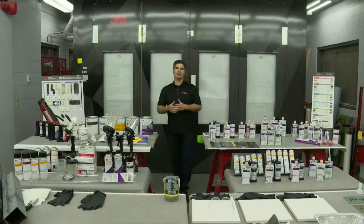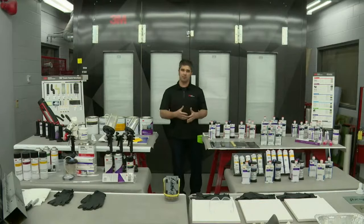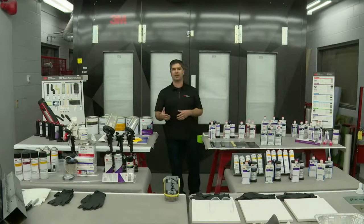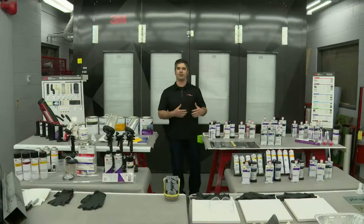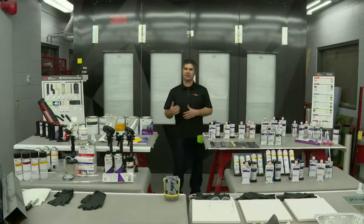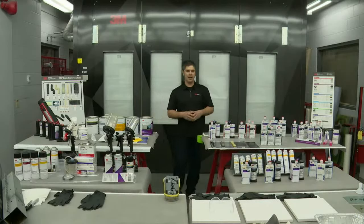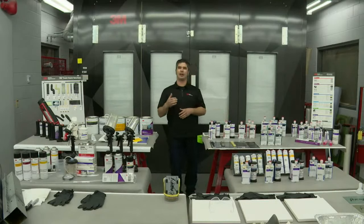So yesterday, if you guys didn't tune into Sean's presentation, he had a great presentation on structural and bonding adhesives, and he mentioned during that presentation the important role that they play in preventing corrosion, and he was spot on, because really in the repair process, this is where it actually begins. When 3M products come into that repair, adhesives are what we're going to be using in conjunction with a lot of mechanical fasteners. They can be squeeze-type resistance welds, rivets, weld bonding, hem flanging, or other attachment methods. And this is where we're going to achieve our initial corrosion protection during that repair process.